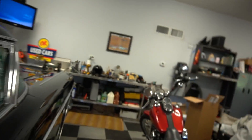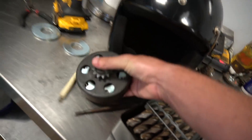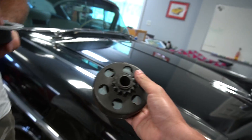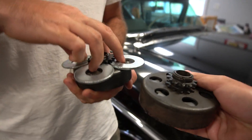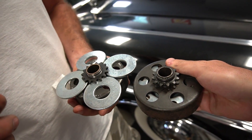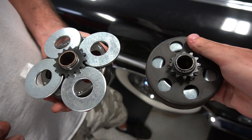Here's a Go Power Sports 35 chain, 12-tooth. You can't see much of a difference right now, but 12 teeth versus 15 teeth. Hopefully it'll get us to the upper 60s at least. I'm going to guess 68 — that's what it's going to do. 70. It's going to put us right there at 70. You got it, boss. Here we go.